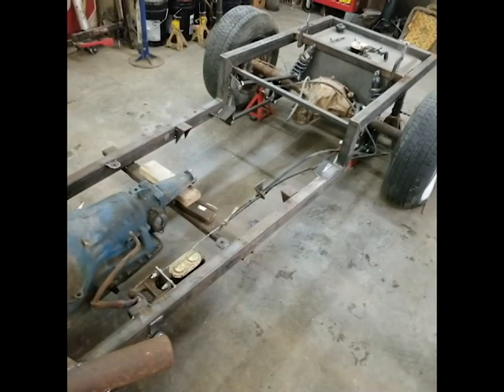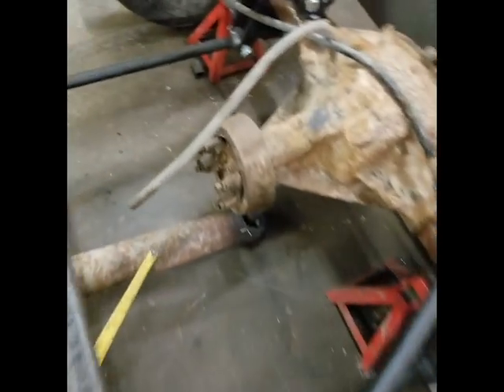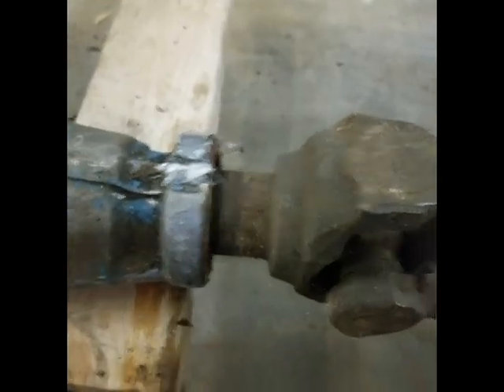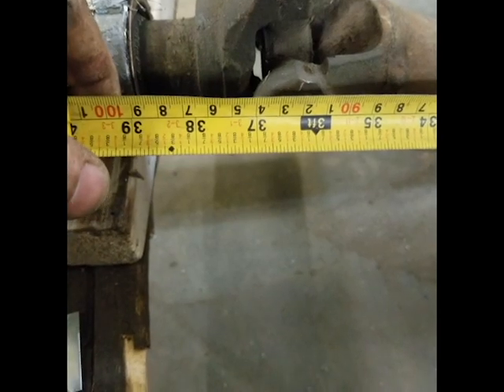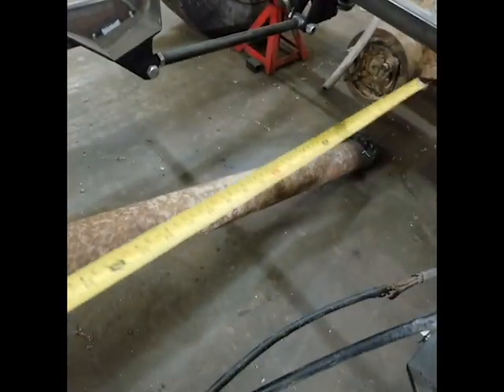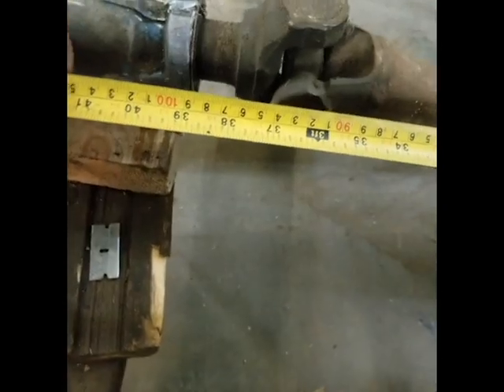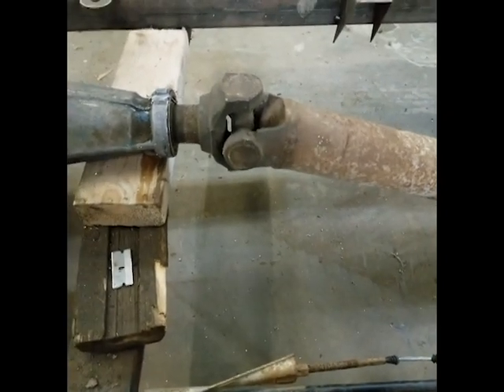I'll show how I do the measurement on the drive shaft. What I do is I put my drive shaft in at the slip — this is about where ride height is going to be — so you can see the drive shaft is too long. I put it in, set my slip, and measure the end. It's like 37 and an eighth — about 37 inches. This is hard doing single-handed, but it looks like it's actually 37 inches.